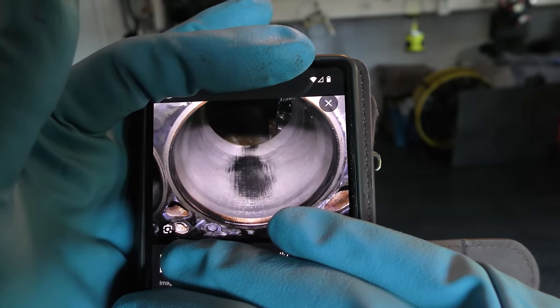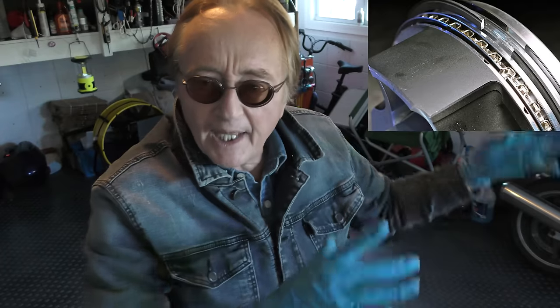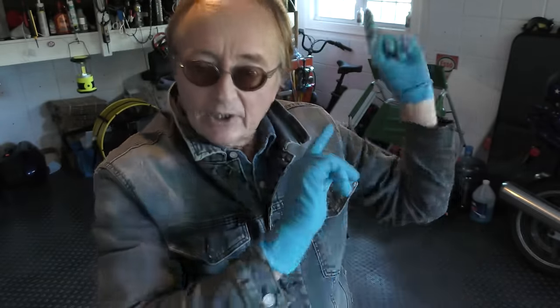If you would have seen scored cylinder walls like in this picture, you would know that the middle ring or the bottom ring — or both — were worn out and they were scoring the side of the engine, and it's going to burn oil. I've seen that a thousand times. A picture is worth a thousand words. You can do all kinds of computer scanning, variable compression tests, relative compression tests — you name it. But once you get inside the engine and you see that, then you know: either you're going to have to rebuild that engine, keep adding oil as long as it runs, or get rid of the car.